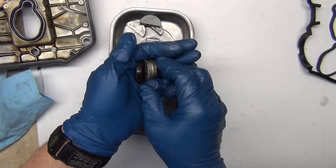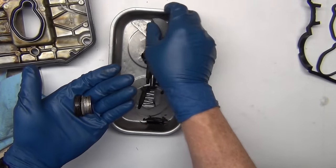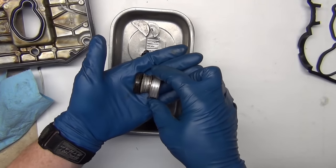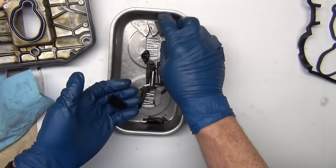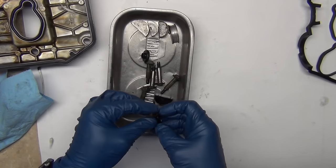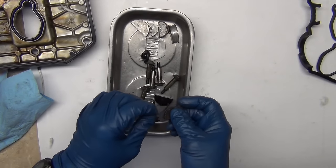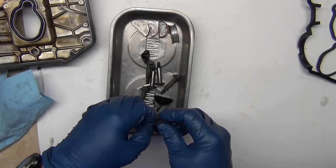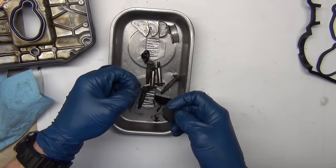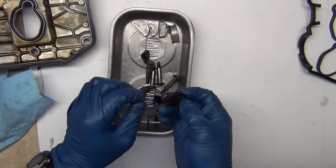One of these got a little bit vandalized when it was coming out - I broke it off just a little because it was so hard and glued in there. I keep a bunch of these on hand but the ones I have are too thick and the wrong diameter, so I'm just going to reuse these. Before I do anything I'm going to get all the glue off. If you try to peel it off or use the gray stuff it comes off pretty easy, and that way you don't get little pieces of silicone floating around in your engine.